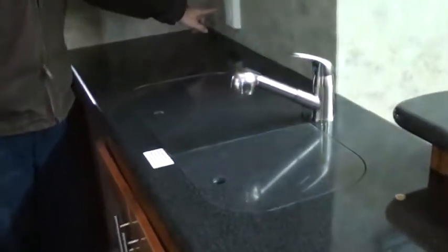You have Corian countertops, which are real nice. But you have that ground fault plug I was telling you about that was outside. This is the push button receptacle that works all that. Now all your outside, all your wet areas, outside kitchen and bathroom are all on the same ground fault plug. And that's this right here. Light right here.